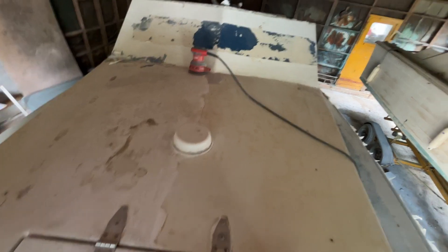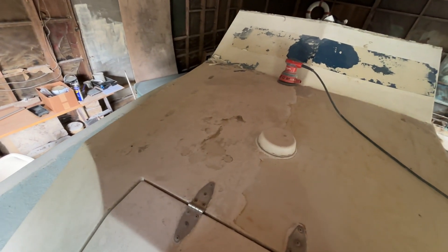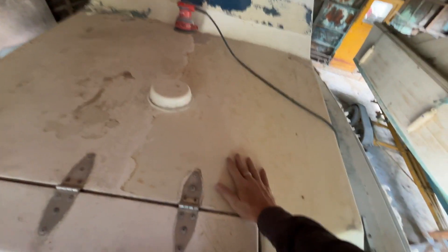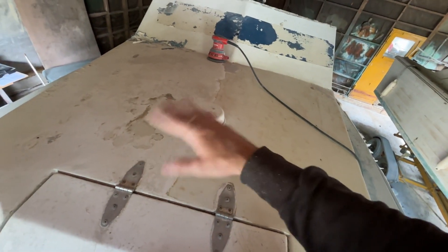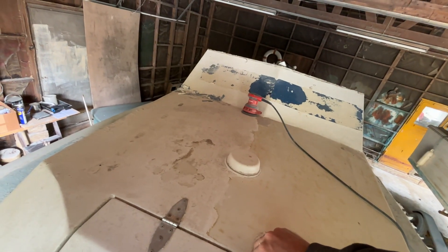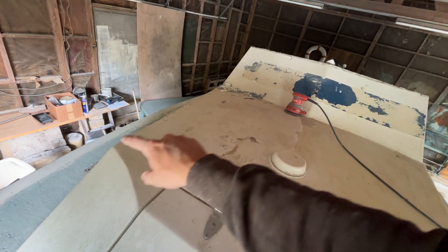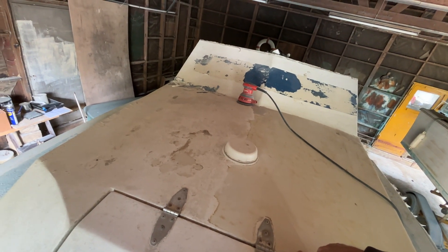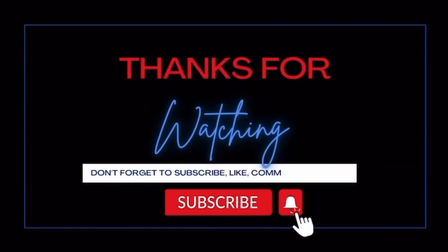There's no way I'm going to get the other half done today, so I think that's actually going to be it for this week. Next week we're going to carry on sanding — that's all we can do. But look, the way I'm doing it I can go over this with 180, repair whatever, and then that is ready for painting. It shouldn't be as bad as the underneath — I'm only dealing with a couple of cracks around the window. I'm filling in some holes with bonding paste. I'll see you guys on the next one. Thanks for watching.